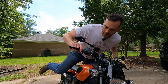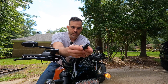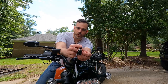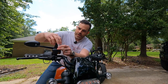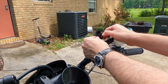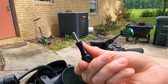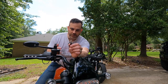Now that we've got the Kimimoto brake reservoir GoPro cover on the bike, we're going to go ahead and attach this GoPro mount to it. This comes with the Kimimoto pieces as well. On the top you've got the standard action camera mount — the three prongs — and then just a standard screw on the bottom that'll go into the top cover. Once you get that positioned with the action mount in the right place, you just twist this to tighten it up. Note: it does not come with the actual GoPro or Osmo screw, so if you're like most GoPro users, you'll have a couple of those lying around.